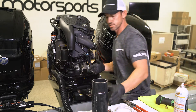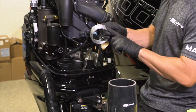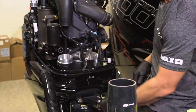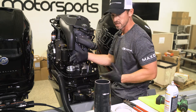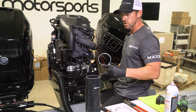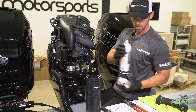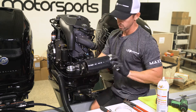The installation is exactly the reverse. Essentially what you want to do is take your billet aluminum adapter here, and you can spray some silicone if you have any available to you — this definitely will come in handy. Spray a little bit on there and kind of rub it around. You can see it'll drop right in nice and clean, and the flow is pretty smooth here — that was one of the main goals we had instead of hitting a wall. The silicone will also be your friend when it comes to installing this. Since this is going over silicone, it is tight, so what I simply do is put a little silicone and rub my finger all the way around so it's nice and lubed up and will slide over. That way you can get your logo facing straight out.